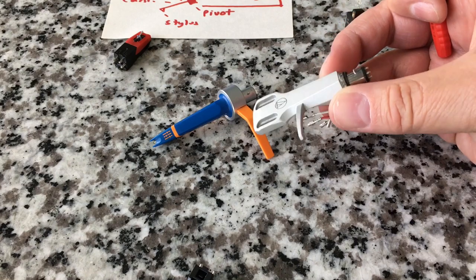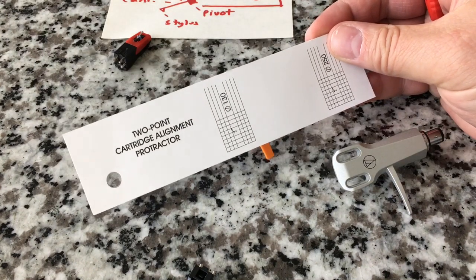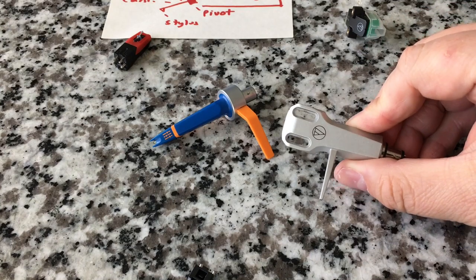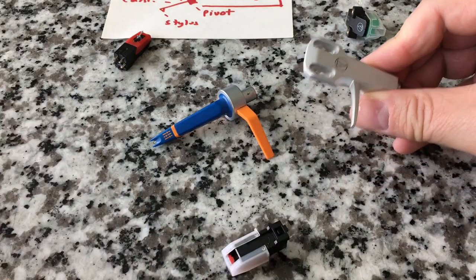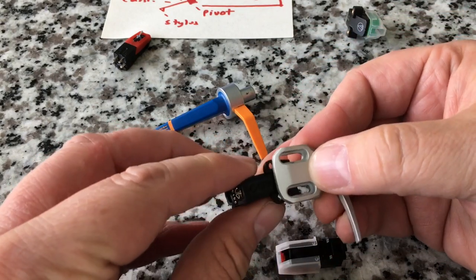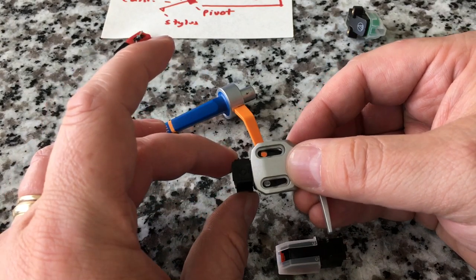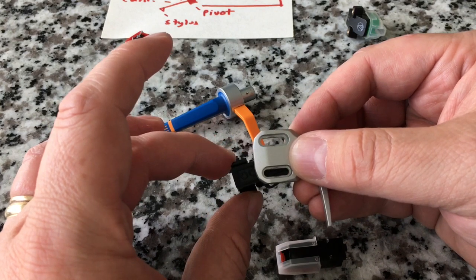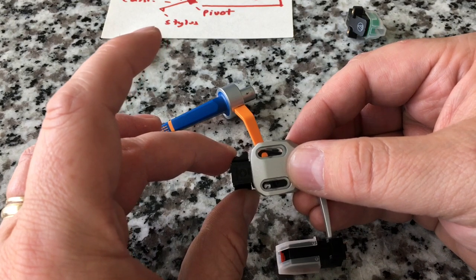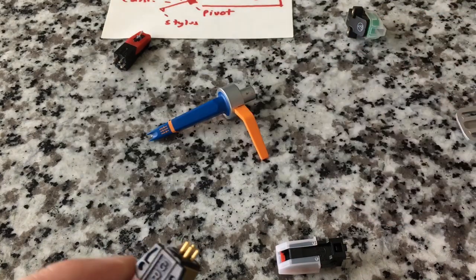You've also heard the term head shell — what's that? It's the thing that the cartridge attaches to, which then attaches back into the turntable. That's a standard half-inch mount. There are also P-mounts and other types. A head shell has a finger lift to allow you to place it. When it comes to alignment, there are alignment protractors and equipment to set vertical tracking, but for most people a visual alignment is plenty — just adjust the screws so it looks straight. If it's obviously off, you'll notice a major change, but for most of us pushing the cartridge all the way forward in the slot gives a pretty good alignment.